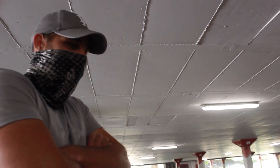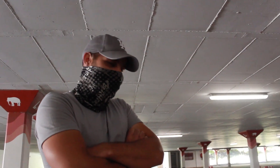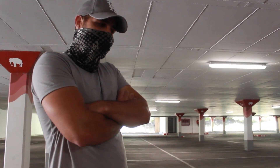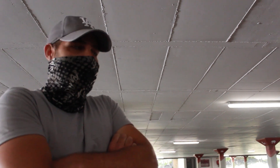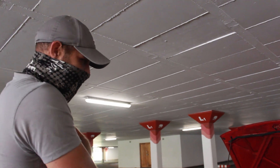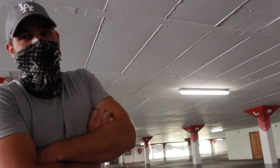It has a 63 mm Power Flow exhaust — one front box, one rear box — and I tried something different by placing the induction at the front bumper. As for choosing 2ZZ over BEAMS: after the first motor blew I considered dropping the dual BEAMS in, but everything was already there for the 2ZZ and it's different — it's not common in these Corollas. The VVT and the lift make it fun.